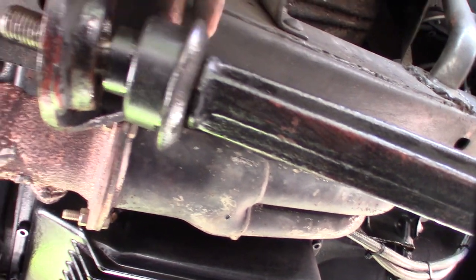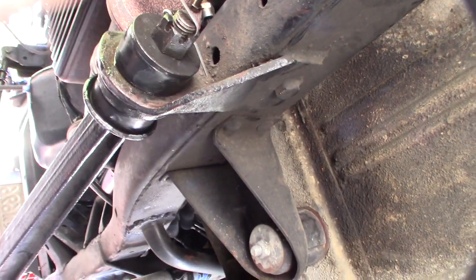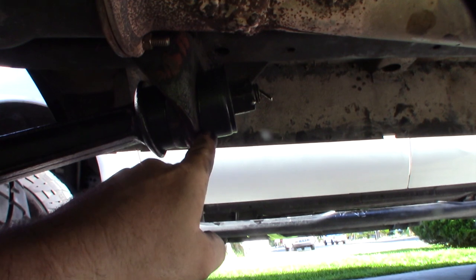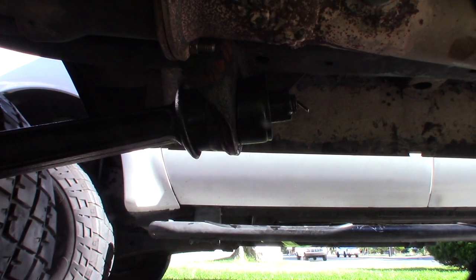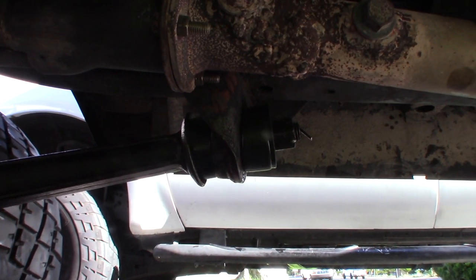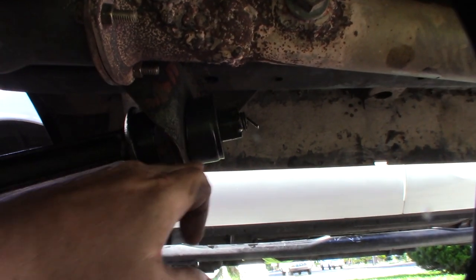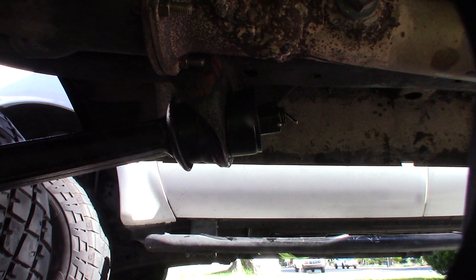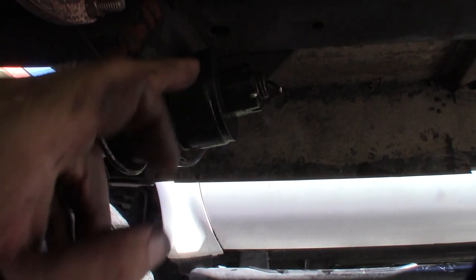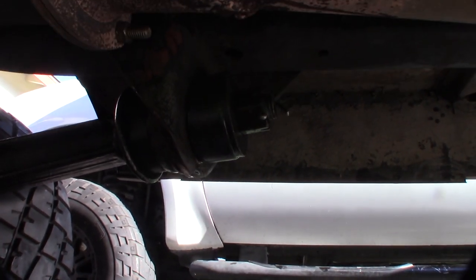This is definitely a pain to do but you can see the angle on the bushing — pretty cool. I got a stainless steel cotter pin in there. Now you can see how they're resting at an angle — smaller up top, bigger down below — so it's actually resting in its natural default position and not strained. I'll put the shocks back on and we're done. These are 30 bucks from Wild Horses — I'll put a link. I love when they improve and make things better.